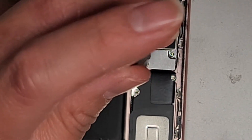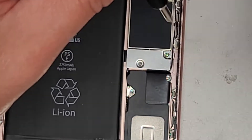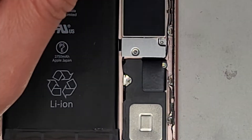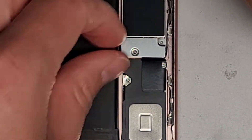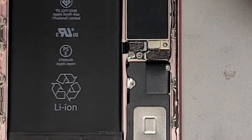We're going to switch over to the PH0 or JS0 screwdriver. You can see the crack closer. Anyways, let's go ahead and take these two screws out, just like this, and set them aside. Again, keep all the screws in order. Now that we've got those two screws out, we're going to remove the metal plate here. Set that aside as well.